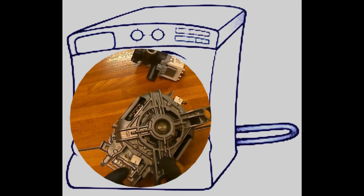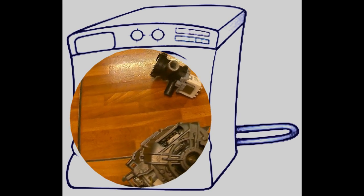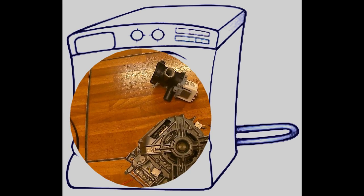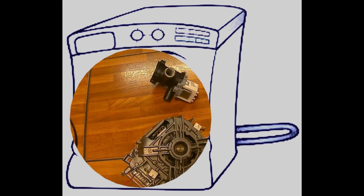Testing the motor. You will find a terminal block located at the side of the motor. The following is a basic test to see if the motor is receiving a voltage when the programmer is asking the drum to spin. Using a multimeter set to AC voltage, test from every pin to earth. If a voltage is present, then that means that the problem is with the internal components of the motor itself